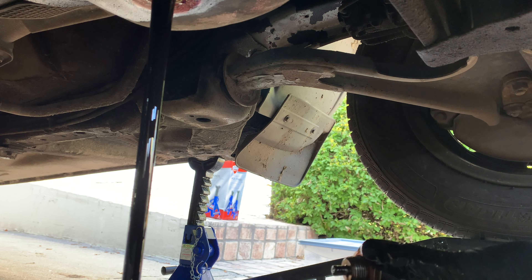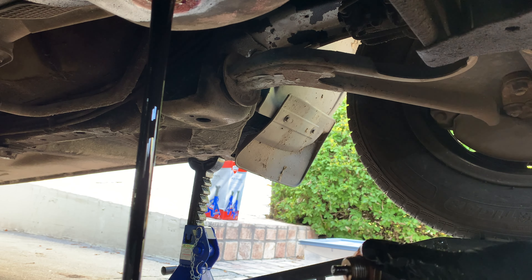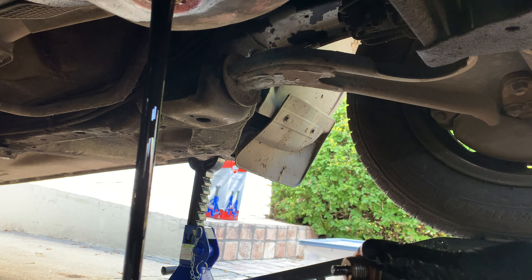As I was mentioning, I'm going to put back the original oil drain plug because the magnetic one didn't work out great for me. According to the service manual, that plug should be tightened to between 44 and 50 foot-pounds, but I honestly don't feel super comfortable tightening it that much. I'm going to use 35 to 36 foot-pounds and check over the next couple of days whether that's enough or if there's any oil seeping.